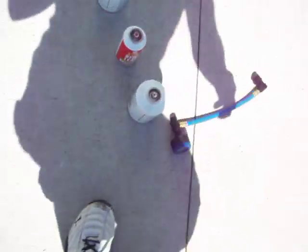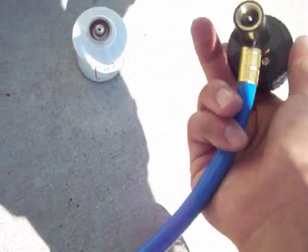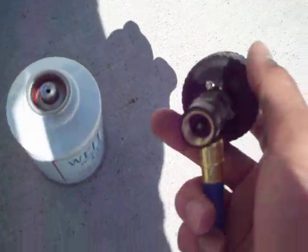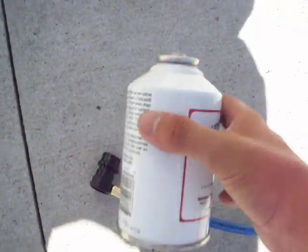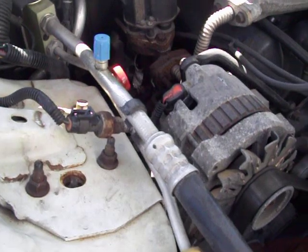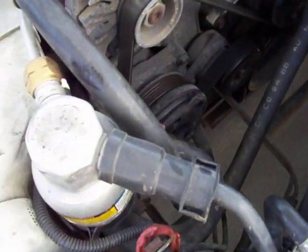You want to force your compressor to turn on, but make sure you have it in the AC position. While your compressor is turned on, fill it up with refrigerant. You want to screw one of these bottles into this adapter, screw it in after you've read the pressure, then unscrew the puncture valve to puncture it, and unscrew it a little bit so it's flowing out. Hook this into your valve and it's going to fill it up — shake it a little bit while you're putting it in. After you have it filled back up, check the pressure again. If the pressure is good, the clutch should kick in by itself again. Just unhook the paper clip, put in the regular relay, and it should be working good on its own.